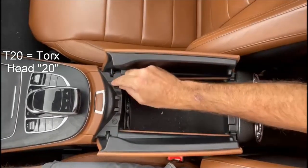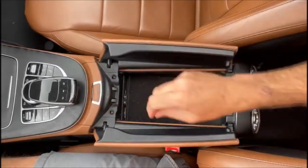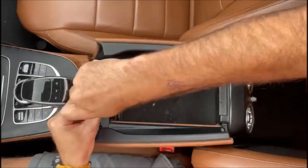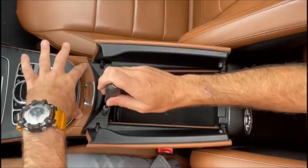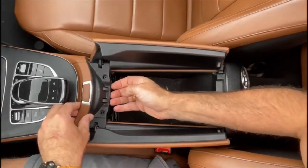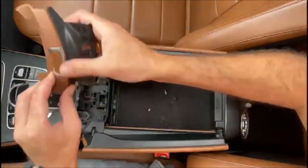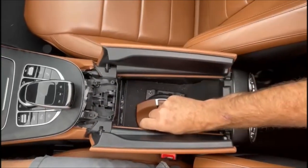The rubber bungs just come out — get your fingernail underneath and they pull up. Then undo these two screws. If you're doing this on the convertible it's exactly the same, but there's a control panel and when you take it up you'll have to remove the wiring and unclip it from underneath. You just lift and slide this back a little bit past the two push buttons to release it, tilt it out, and set it aside.